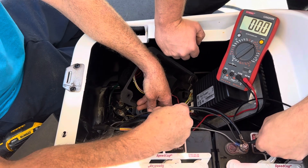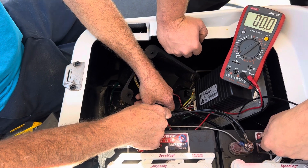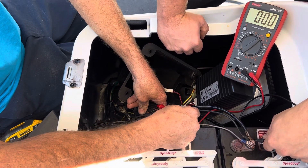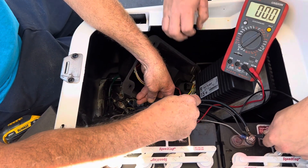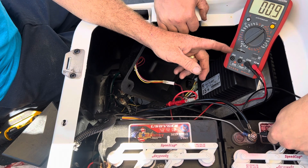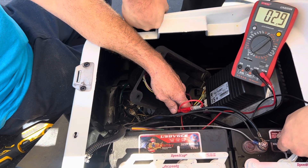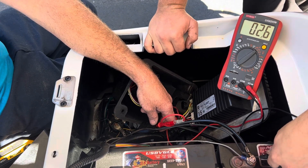Then your black and white wire here — your white wire is a constant output to your pedal position sensor, also known as the inductive throttle sensor. You will have 14 to 15 volts DC — that's good. And your black wire will be your return from the ITS and the floorboard. When you hit the gas, it should go up anywhere from 2.5 to 2.9 volts DC at full pedal. I have full pedal now. So that'll let you know you're getting full pedal — your gas pedal's working, micro switch is working, pedal switch is working.